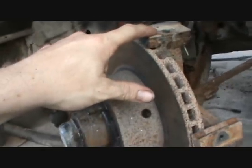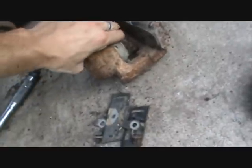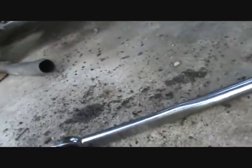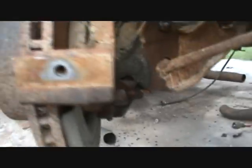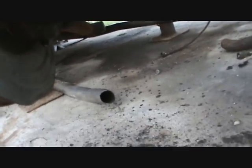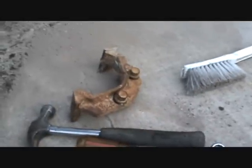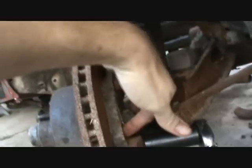The caliper is off — just a bolt here and a bolt here, I think it's a half inch. I don't ever try to reuse these anymore because when they're this old they're probably well on their way to being rusted up if they're not already. Basically to me they're cores — you'll need to turn them in as a core. Next I'm going to go ahead and take the caliper bracket off just to make it easier to get to things. Two bolts hold it on, so that's out of the way.